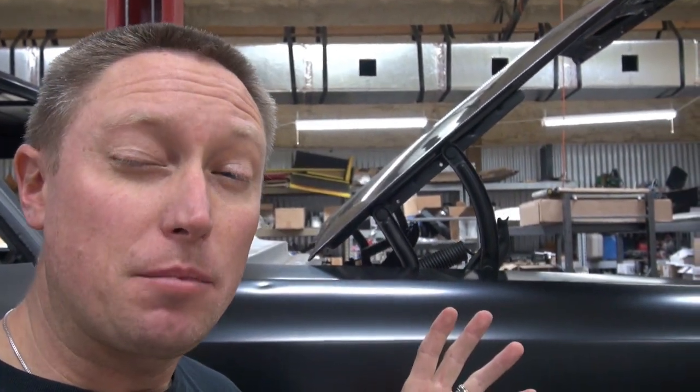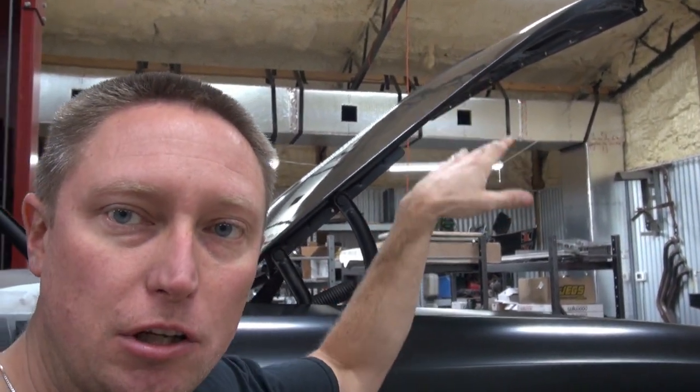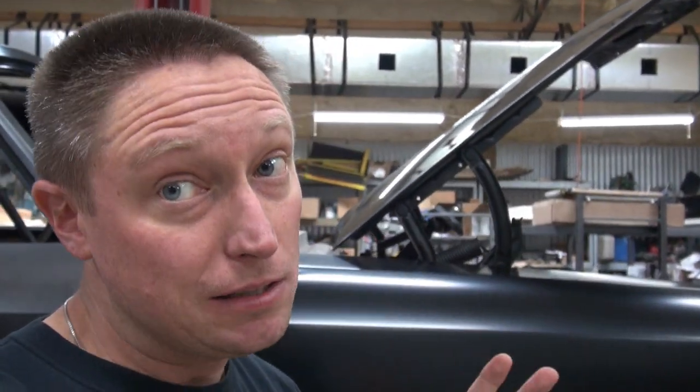One of the things that I noticed that I'm not going to show you here is if I start pushing on the end of that, pulling actually on the end of the hood there to start closing this car, you're going to notice that hood start to bow to the point that it kind of gets a little bit uncomfortable. So luckily I noticed this the very first time I went to go close the hood. I stopped before I did any damage, and I said, wait a second, Ian, these are the original steel springs that are for the big steel hood. You can't do this. Don't violate that rule. So I just let her go back up, and not just that, you want to be careful letting the hood go back up, because if you just let go, it'll go. So you got to be careful with that when you're running original hinges on a carbon fiber hood.